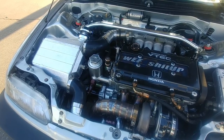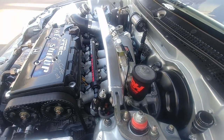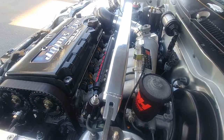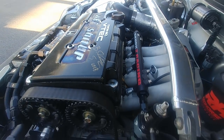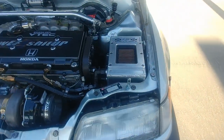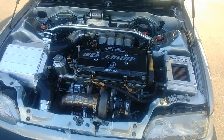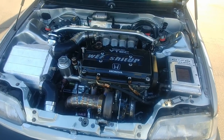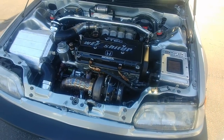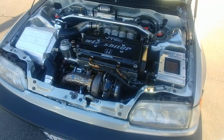It's sitting on a Skunk2 composite fuel rail with the Aeromotive pressure regulator. Skunk2 throttle body, 70mm. It does have a full water-to-air system — it's got a Bosch water pump and an FPP water pump to help with the backflow. Wastegate and Turbonetics blow-off valve. It's got the T1 — a full distributor delete using the T1 Hall Effect sensor made by T1 Development, matched with the Golden Eagle intake side cam gear and a 1320 belt tensioner.